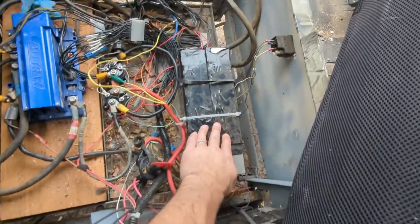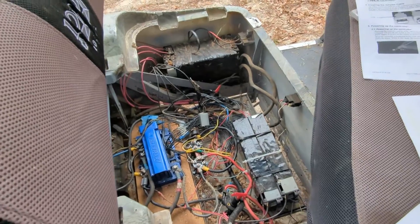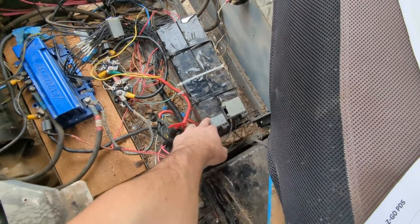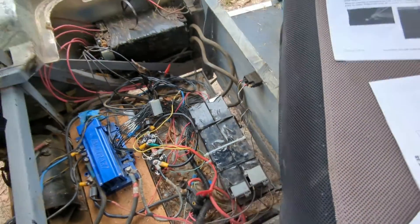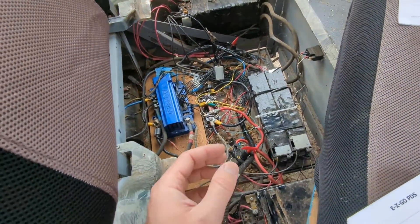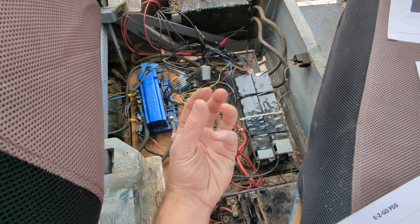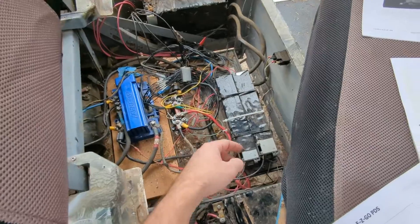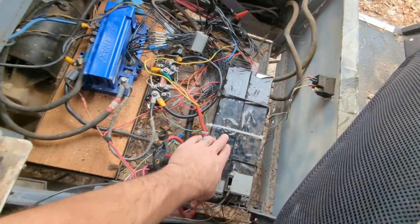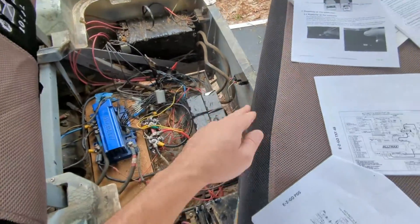Here's my scenario: I put lithium batteries into my cart. There are four here, two here, and four there — 48 volts total. These are lithium batteries from a server backup, used ones, 300 watt-hours each with Panasonic cells inside. They're wired with four in parallel and about 13 or 14 in series. Each can do 100 amps easily for the first five seconds before tapering off.